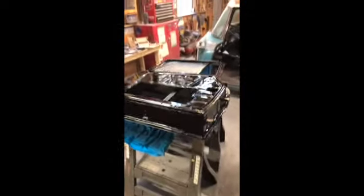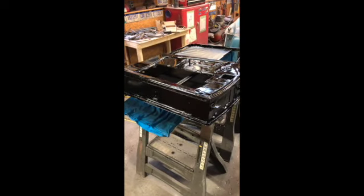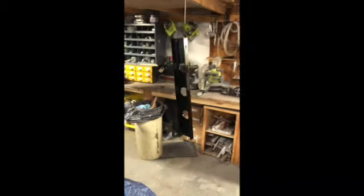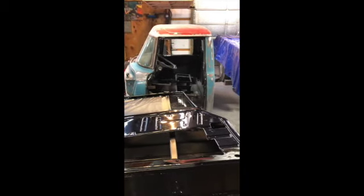The last thing I did before I went inside last night was some single stage paint. The new door is completely prepped on the outside, but I left the jams and inside at 220 — and you'd really not know the difference. I was shooting acrylic enamel single stage on this. The jams are all painted, the interior of the door is painted, and I also got the rear triple marker light panel and the battery box lid done. Both came out really nice. Now we're gonna get this place blown out and ready to mask and shoot some primer sealer.